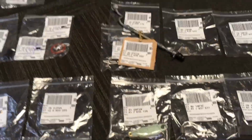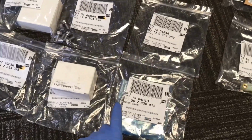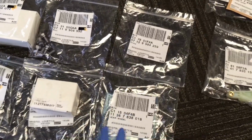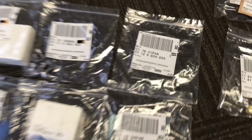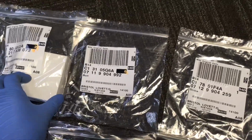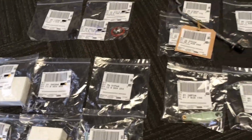We've got all the BMW special tools here to do all this, specifically setting the backlash between the Vanos high pressure pump gear wheel and the crankshaft gear wheel. That's quite specific. There's a few other tools for removing the front crank seal nicely without damaging it, and also installing a new one. We'll try and get those videoed in this process, but that's all the parts there.